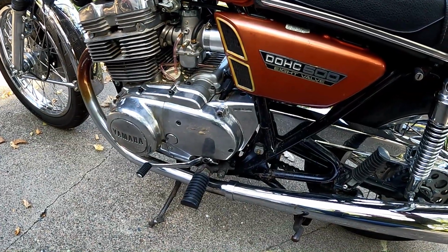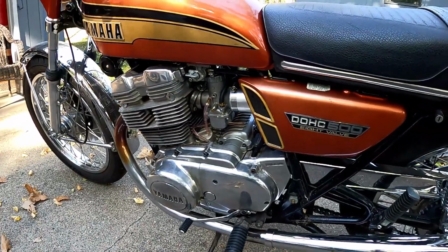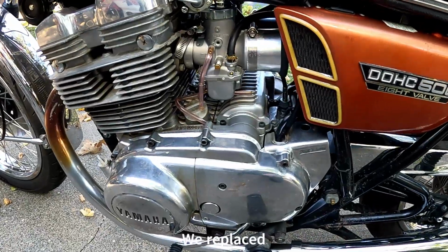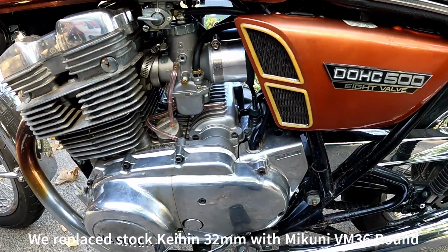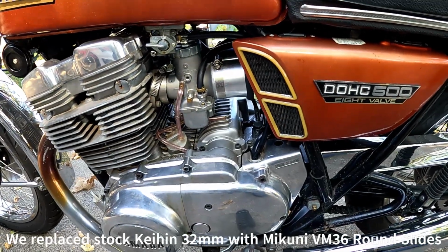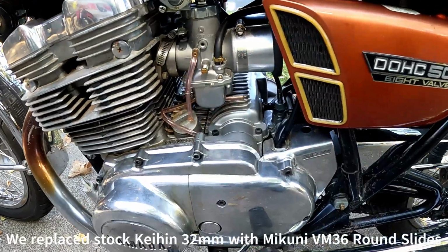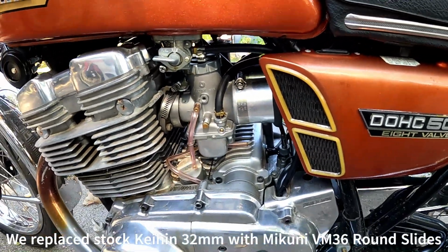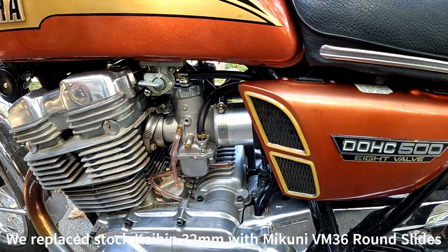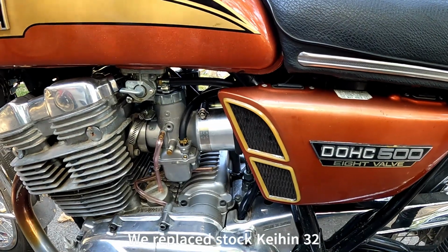And the biggest changes that we made, again, you all know I'm a fan of letting bikes breathe, is we got larger Mikuni carbs, and we had to go with a much larger size than the original stock, and I'll put a link in the description of kind of what we did there. And we're still in the process of adjusting the jets on that to get it to fit the engine performance, so it's running a tad rich still.